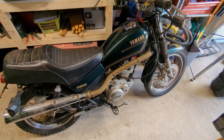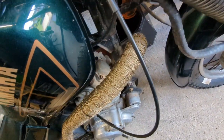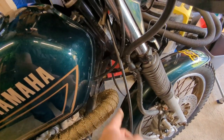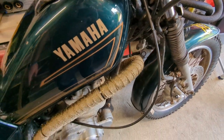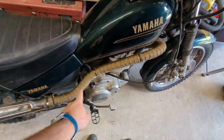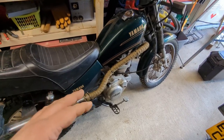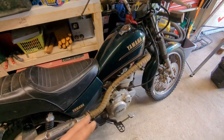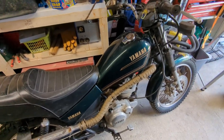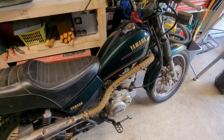I've tidied up the garage and I've put the heat wrap on the exhaust. Gone with this nice gold stuff so it matches the gold on the bike. Gone all the way around the front, done a bit of rejigging of cables just to move stuff so that it falls outside of the danger zone, although the temperature is much reduced with this wrap on. A bit of a tip if you're ever fitting this stuff: if you can take the exhaust off to do it, do — that's how you get this nice even pattern, because you need to put a lot of tension on it. And secondly, don't do this stuff dry. Soak it first. I popped mine in that sweet shop box there, because that keeps the dust and the fibreglass down. Otherwise your hands will itch like crazy, as will anything else in the vicinity, and you'll breathe it. Wet it down. Take the exhaust off if you can. Keep it nice and tight as you're wrapping it.